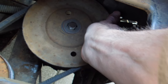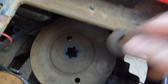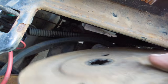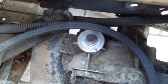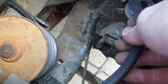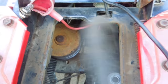That pulley comes off — you'll see there's a star pattern on the pulley, kind of similar to the blades. You can see the matching star pattern on the drive part here. So now the upper transmission belt will come off — it comes off like that.